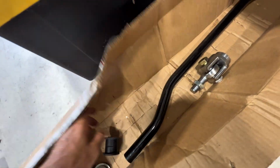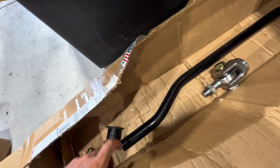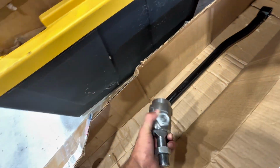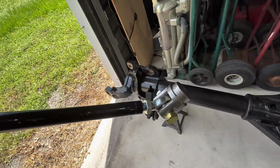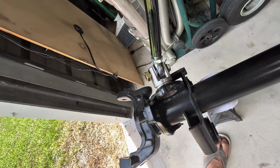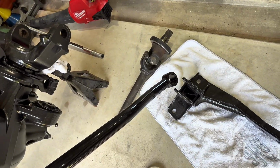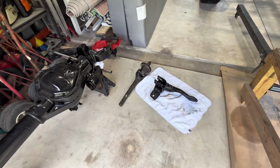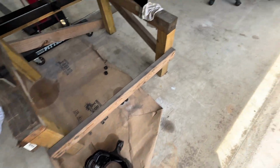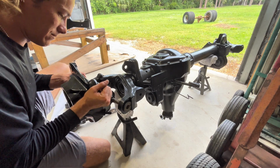And then here's our track bar, which is also freshly powder coated. This is from Skies Off-Road Design. They make a lot of good stuff for the OBS, as I said before. This will screw in on this side like that. So this will slide in the axle just like this. Slide in there, and then the other end with the bushing in it will go up to the track bar bracket itself, which will go in there. So that'll be the next video once I actually roll the axle up underneath. Hopefully we can get that bracket in, get these knuckles on. So stay tuned.